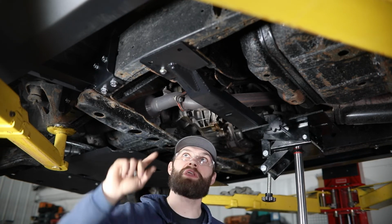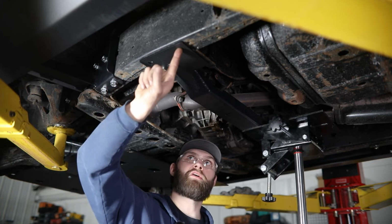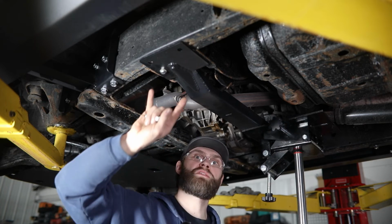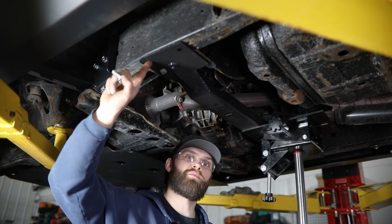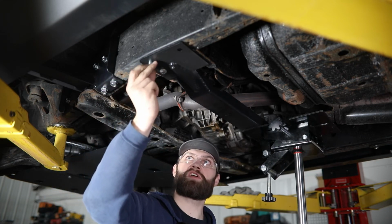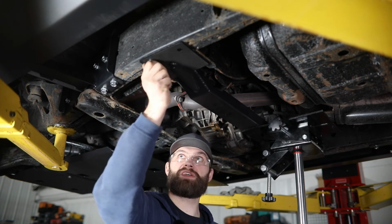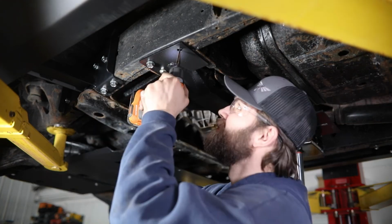Now once you have that located with the 2 3/8 bolts, you'll need to come out here to these 2 outer mounting holes, drill those out to 7/16, and tighten in 2 1/2 inch self-threading bolts. Now we already did the front bolt on each side during our R&D process, so I'm just going to start these so that I make sure my back hole when it's drilled is aligned with our existing holes. Then I'll come back here and drill these out.